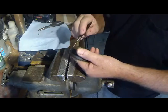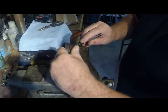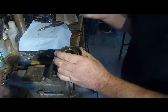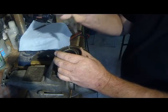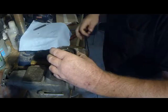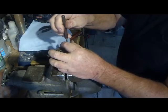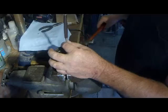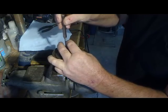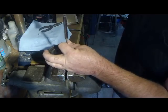Now what we want to do is place this rivet on this punch without losing it and get that on there as squarely as we possibly can. What I might do is hold that rivet on this side, line that up. Okay, that does look pretty good. Now the trick is going to be holding this all together and be able to drive this rivet shut. So this may take a little bit of practice here. Bear with me if this one doesn't work out exactly as we'd hoped.